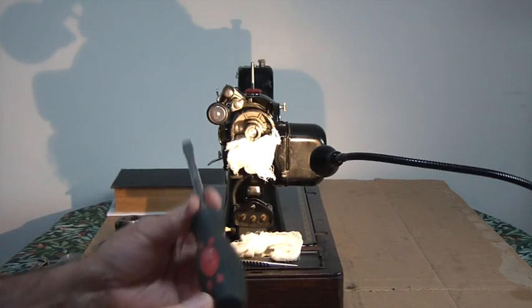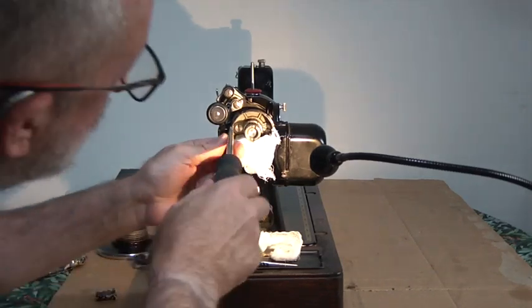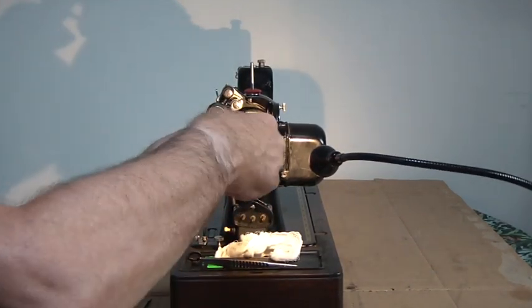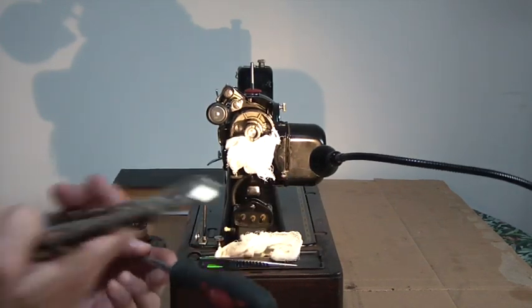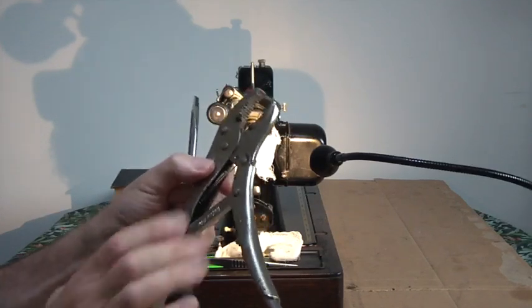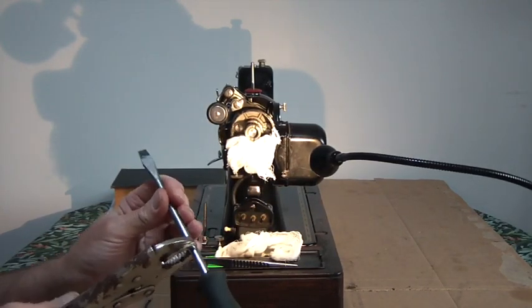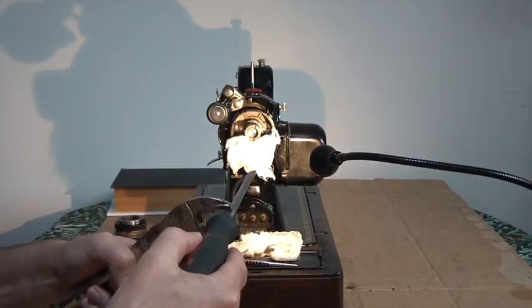The other way is that if you've got a round shafted screwdriver, a large one, and put that in, you'd have the same problem trying to undo. So what I would use then is what we call mole grips in Britain, and you would then attach that up, and then you've got an extra bit of leverage on there.